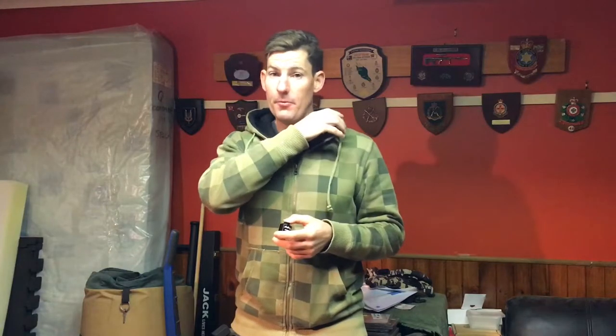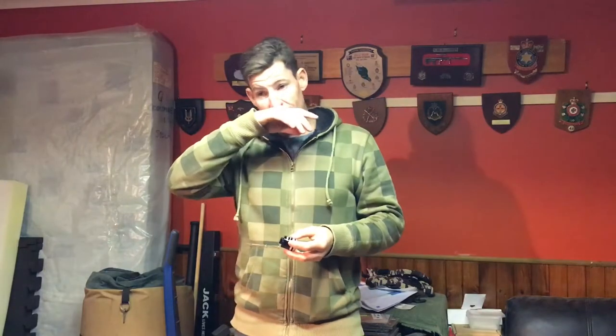I ended up back at 87 psi. As I showed in the Death Track video, I had the Luftcap in the fork and the Super Deluxe on the back with the Meg Neg — which taught me a fair bit about negative air volume tuning. At Death Track when it's dry it's very loose, and you want your bike as compliant as possible without being sluggish or bob-y. You dial out that bobbiness with low-speed compression, but there's only so much you can do if your spring is too soft.